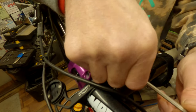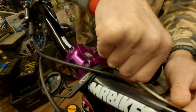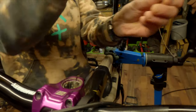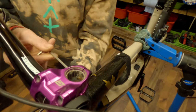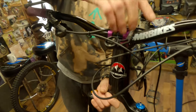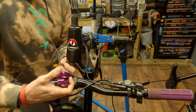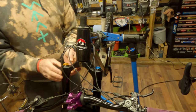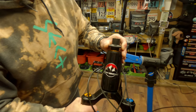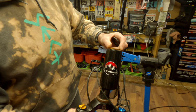As you get your last bolt properly undone, you want to have one hand on the forks just in case they drop out. Get rid of the allen key, the bars should come off and just hang carefully. Take your spacers out if you've got them, and you can leave the top bearing in there.